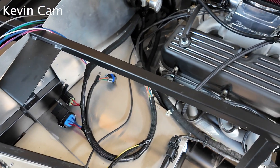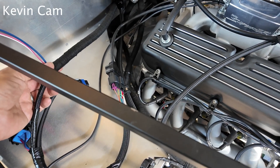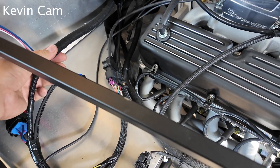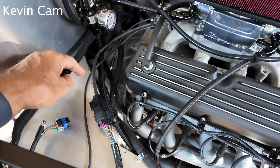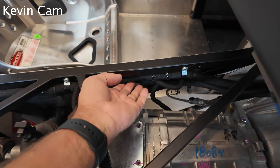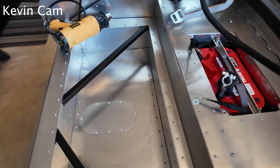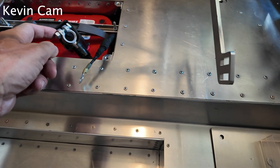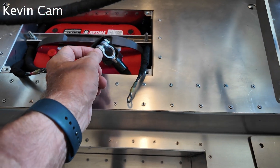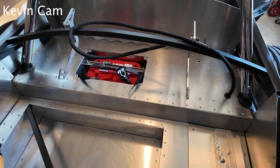Taking a look via Kevin Cam — you can't quite see it because it's underneath the wire loom now, but the battery cables, red and black, are in there with some extra heat resistance. It's tucked in nicely and picks up some other looms. You can see it going down the middle, underneath to the battery, popping up on either side, and with the appropriate attachments it fits onto the bolts with the main battery cables.